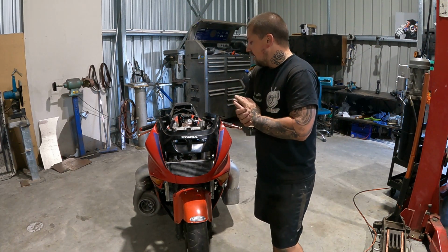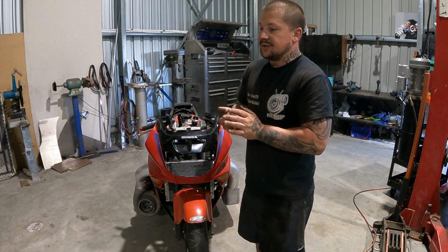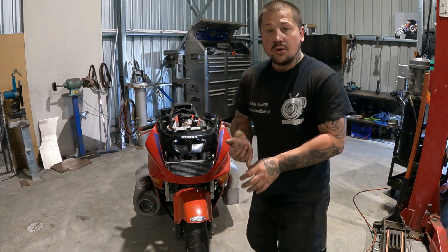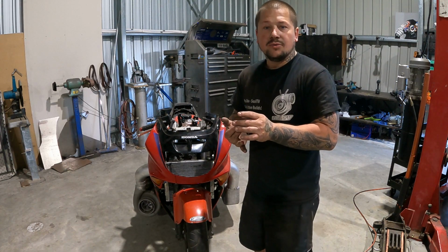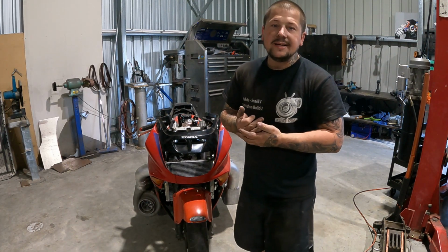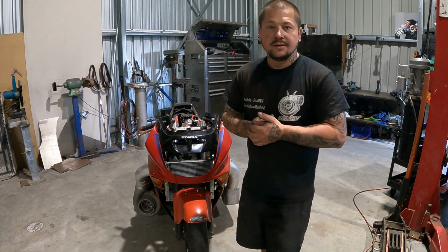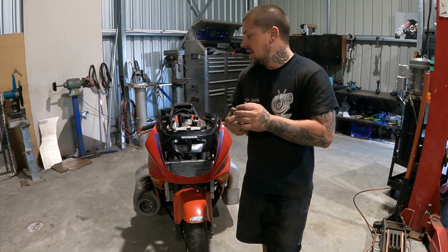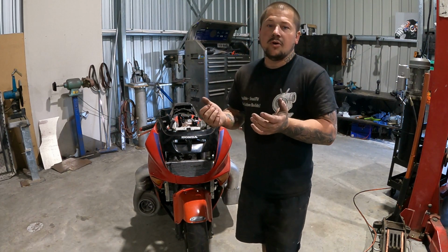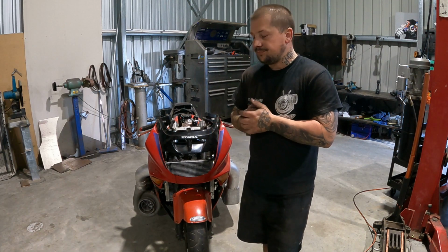Now that that is taken care of, what we really need to do now is oil lines. So oil feed for the turbo, and also oil drain. Oil feed's a really easy thing. It's just a dash four straight off the oil pressure sensor there. So it's only the oil drain. That's off the sump. Got to put a fitting on the sump there.